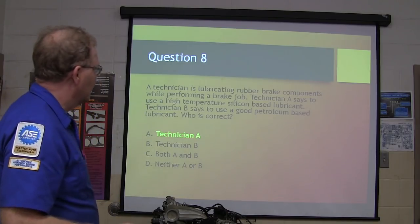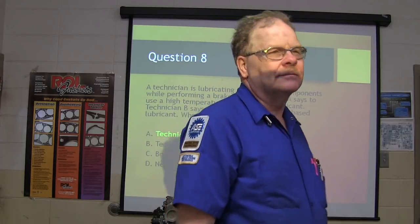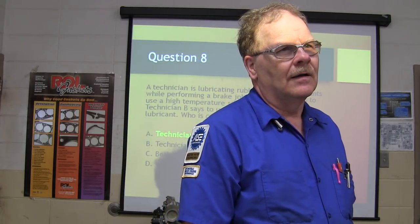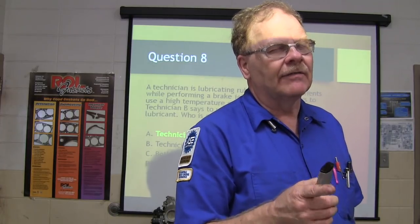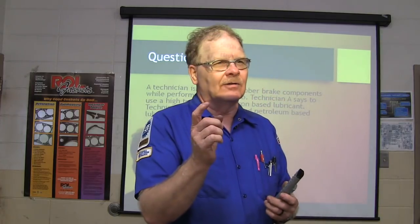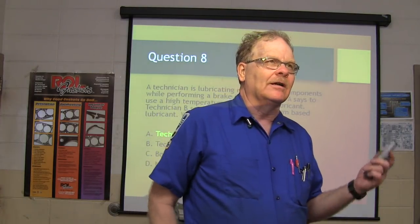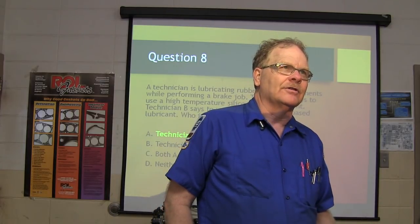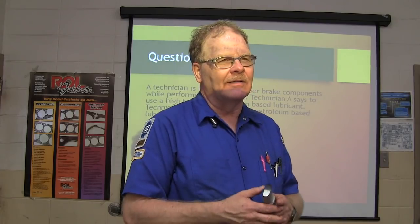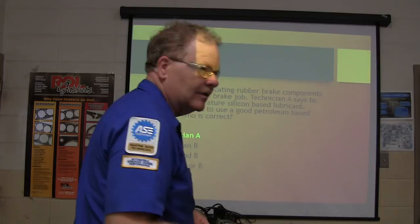Technicians lubricate the parts you're going to use. What is a high temperature silicone based lubricant? Do we have any here? That is good stuff, but what about silicone dielectric grease? You know, the kind that's like a little shaving cream can? That stuff right there, toward the end of when I was working at the Ford dealership, Ford started saying they wanted everybody to use that for caliper slide grease because it worked better than anything else. Because the temperature doesn't bother them. Right? Silicone is temperature resistant.